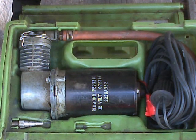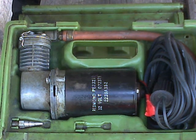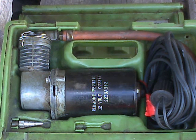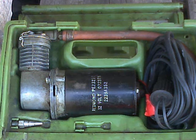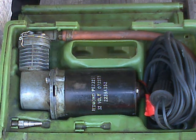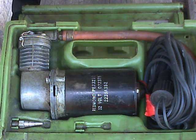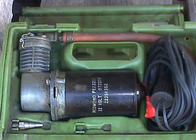I could use the late 1970s vintage Coleman Inflate-All 90, which I have been using, because although I put it out to retirement probably 20 years ago, everything else I've had since has been failing. That will work, but you do have to add oil to its foam rubber air filter to basically use the oil as a piston ring that was never manufactured in there. So there's that as an option.